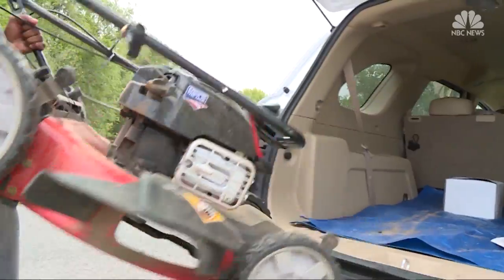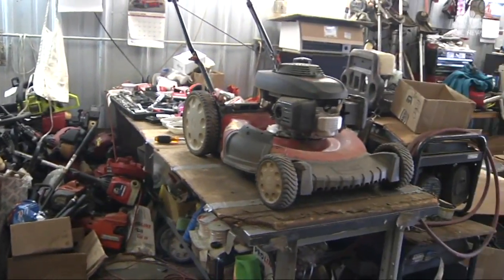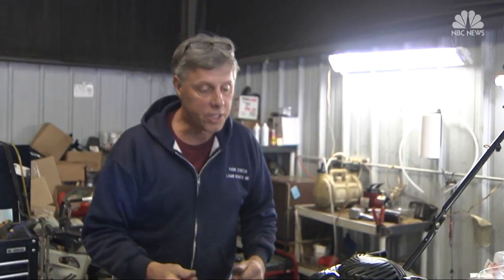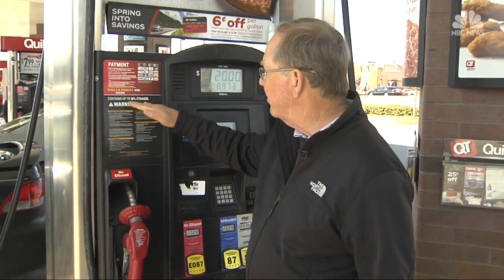Paul Hope at Consumer Reports just wrote about getting yard gear ready for spring and summer use. He and Harnock say draining the old gas might be necessary, especially if it has too much ethanol in it. Ethanol is really hard on the engines of outdoor power equipment — it's an alcohol that dries up all the rubber products inside the motor. So going forward, just make sure the gasoline you're buying contains no more than 10 percent ethanol, or better yet, search out a station where you can purchase ethanol-free gasoline.